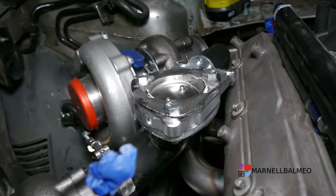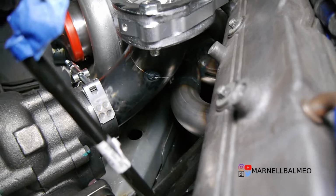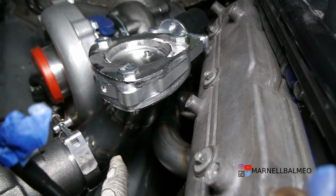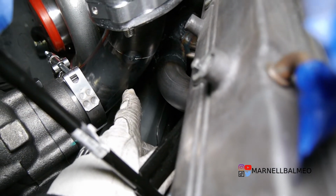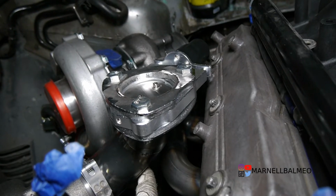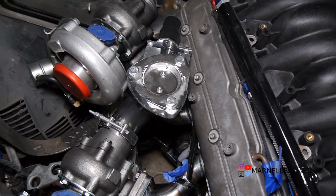But as far as this thing is concerned, I'll probably put a cover here, some sort of heat shield or something. Alright, as you're watching this, you're probably wondering, oh man, he screwed up. Put an electric cutout right there, and there's no more exit for the exhaust when you close it. That's true, except I'm actually planning to route this one to the bottom, so that will be my regular exhaust with this thing fully closed.